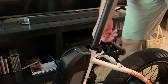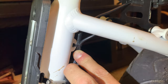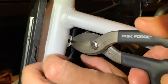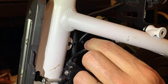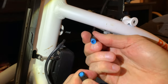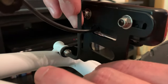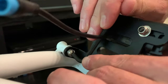Step number one is to remove the seat and remove the battery. The next step is to cut this little zip tie to free the cable, trying to do this without severing the wire. After we have this snipped, we're going to disconnect the cable. The next step is to remove this tail light completely off of the frame using an Allen wrench.